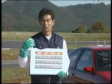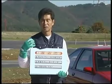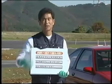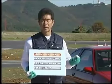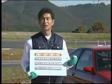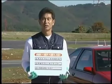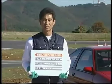Say you're in a braking drift, and beginners often pull the e-brake, right? In that case, you need a decent pair of rear brake pads to get the rear tires to lock by pulling the e-brake. Plus, if you're wearing poor grip tires on the rear, it's easier to lock them with decent rear pads.